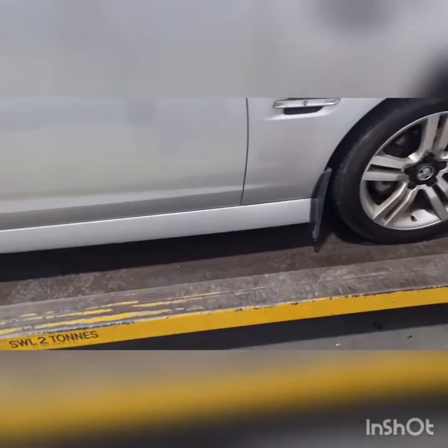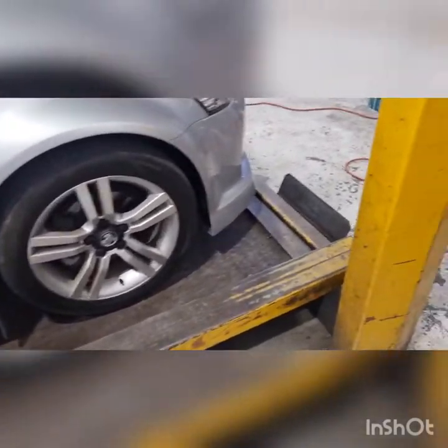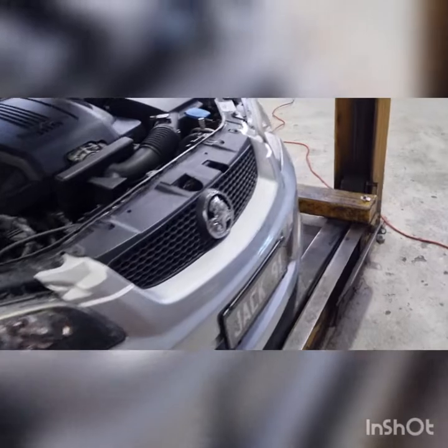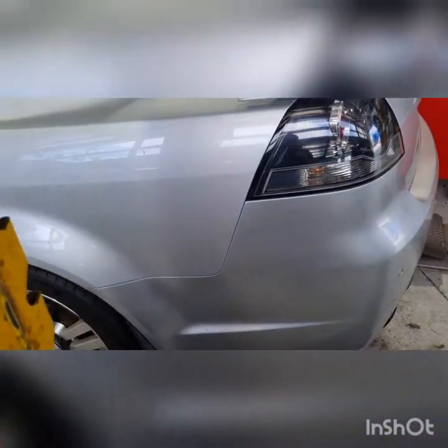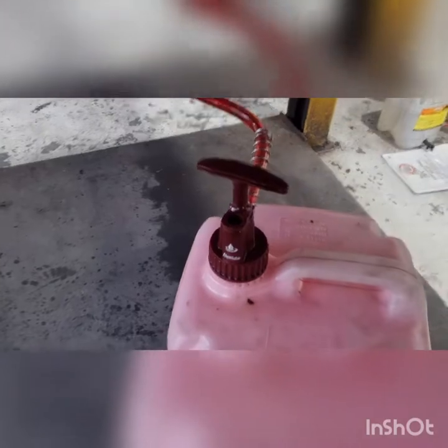So we're just bringing the car down. We're going to have the apprentice jump in the car. We'll take it back up. I'll start filling it up. And when it starts running out, he'll start the car. He'll pull it through the gears. And you'll see that level sort of start pumping around the gearbox.